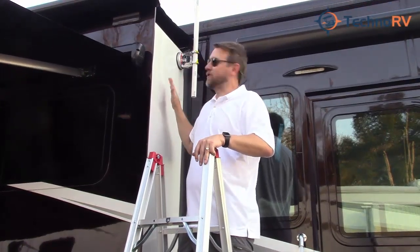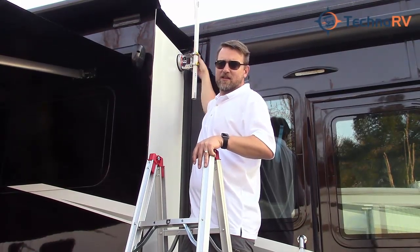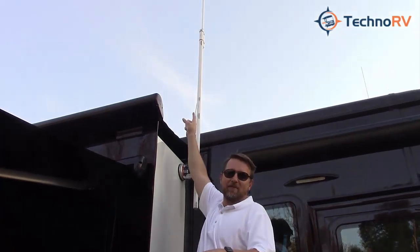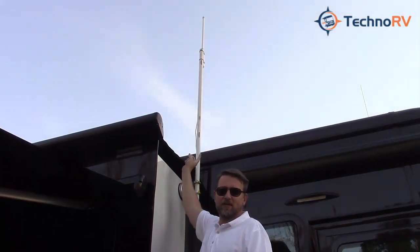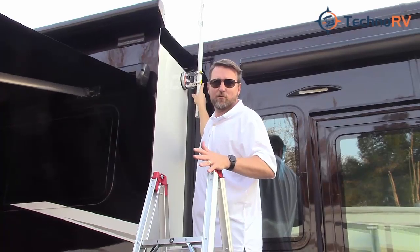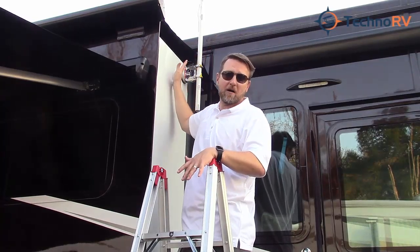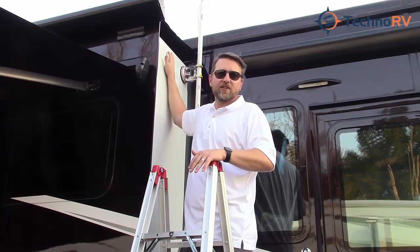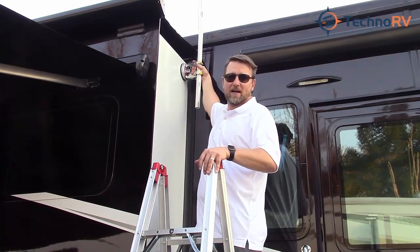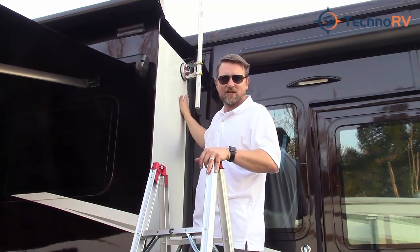This is now the ultimate solution. We've got our suction cup mount right here, and instead of putting the antenna directly into the brackets, I've got a one-inch by five-foot PVC pole. I put this in the bracket and then mount my antenna at the very top of that using a couple of zip ties — they actually come with the external booster tube kit. Now my height is really good; it's going to be great for line of sight to the access point. Whether my access point is over here or on the other side of my RV, my antenna is well above my RV and any other RV in the park. My install is also very clean because I've mounted this so close to my entry point that you really can't even see the cable — I've just tucked it in behind the gasket on the slide.